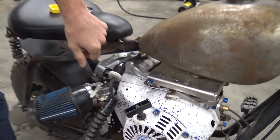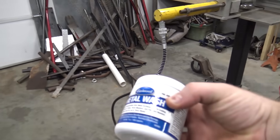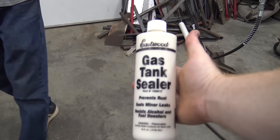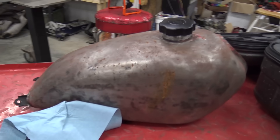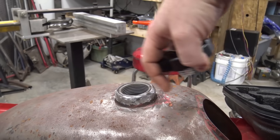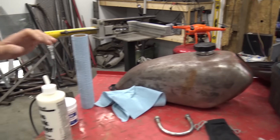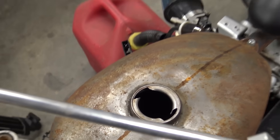We never coated this tank and you can see there's been some gunk in there. Once we pull it, we're going to clean it and coat it. We are sponsored by Eastwood, who sent us metal wash to cleanse the inside of the tank and get it ready for coating, plus a gas tank sealer. Links will be in the description. We also welded on a factory lid from a Duramax gas tank, cut out the bung, welded and ground it down. Once that's done we can do the same process. We're just going to follow the instructions on the back — how many teaspoons to put in — then let the gas drain and pull that tank off.